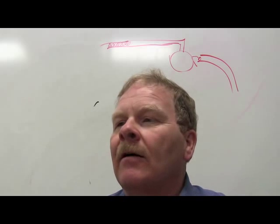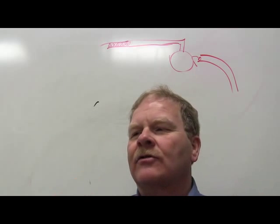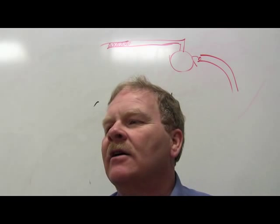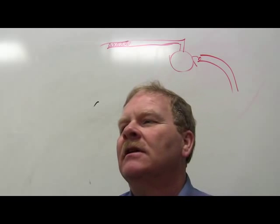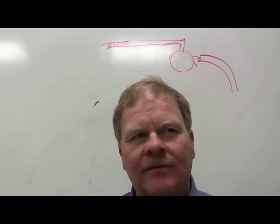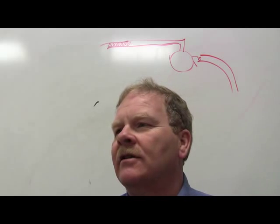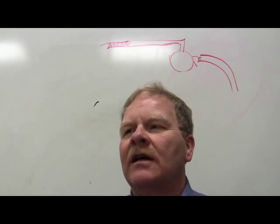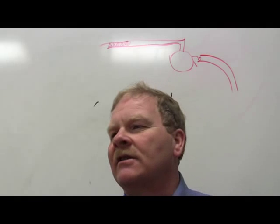When the customer takes their hands off the wheel and the car goes straight, you'll get more alignment business from their referrals. Key angle tips: if the rear wheels are not adjustable, establish the rear axle thrust line and align the front wheels to match that direction. If the rear wheels are adjustable, adjust individual rear toe to create a zero thrust angle, inline and parallel to the geometric center line. Left and right camber should not differ by more than half a degree — that applies to both front and rear axles.